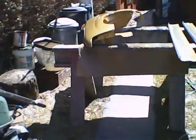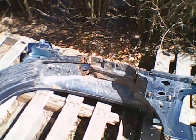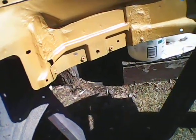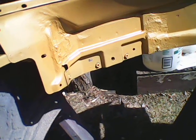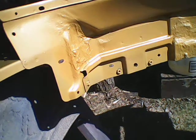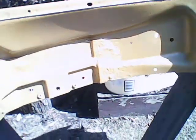This is the end result of taking your time. I got another panel over here that I actually paid for — I was disappointed, but I'm going to dress that up, fix it, weld some metal in. I welded metal in this fender — there were small holes but I went over them with glass to make them waterproof. I have seam sealer that hardens, but I don't paint over it because the chemicals in seam sealer will start drying the paint beyond the proper hardness, which is why paint starts peeling. We don't want anything peeling here.